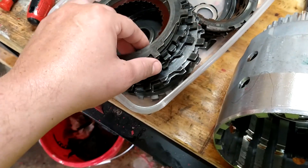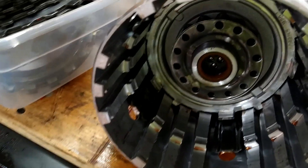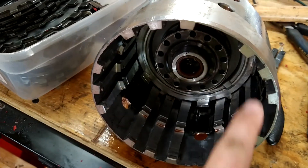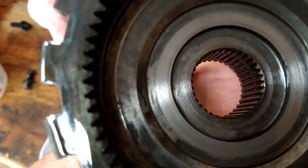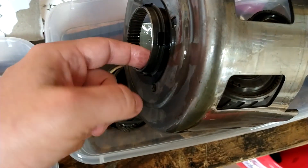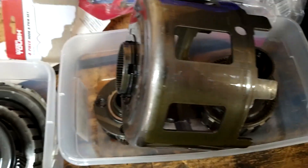I'm going to buy the kit and replace all the steels and clutches and all that — all of them. I'm going to try to replace everything I can. I don't see any grooves or anything chewed up on this aluminum. All these gears in here look just fine. For like a hundred bucks or so you could buy new shells with a hardened surface. I might do that actually, because with the 454 there's probably a little more torque than what the '91 Camaro had.